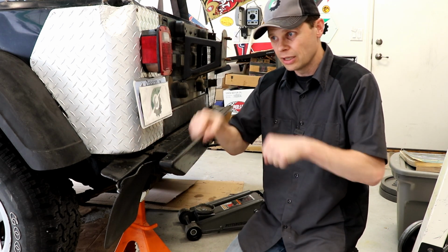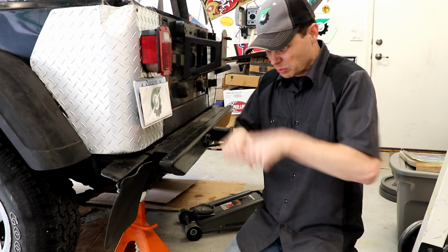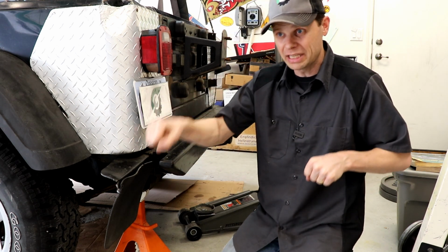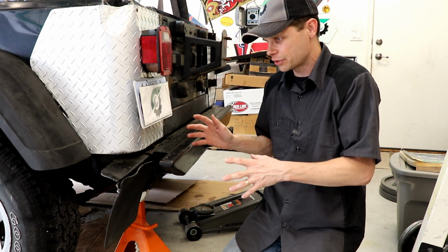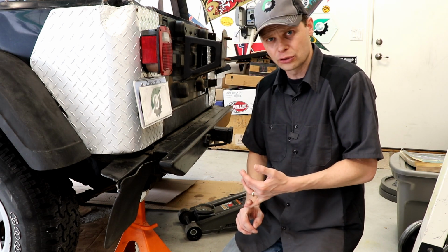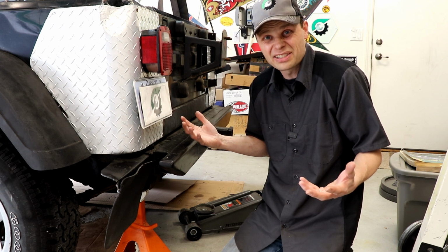Like being on a bike where you can pedal really fast and you go really slow. You can just churn over real rough terrain, and you're just kind of creeping along. Versus putting your bicycle in a real big gear would be great on the highway and going at a faster speed, and that's kind of the same thing with the gear ratio. The 4.10 is a little bit better for low end, off-roading, higher torque. 3.21 is better for fuel economy, highway speeds. You go a little faster.